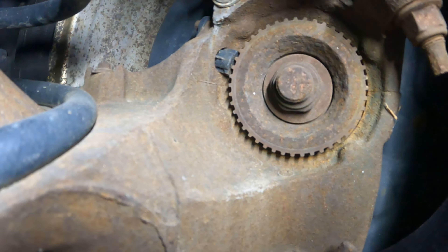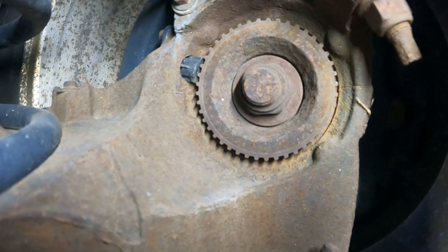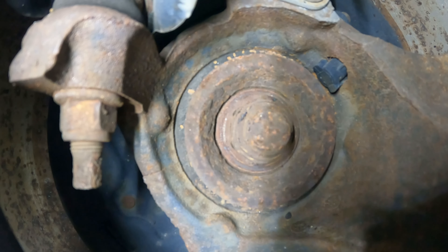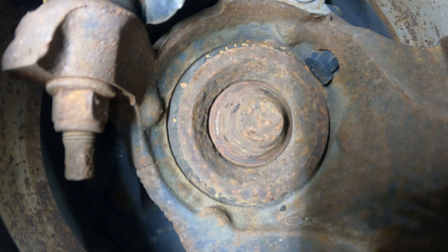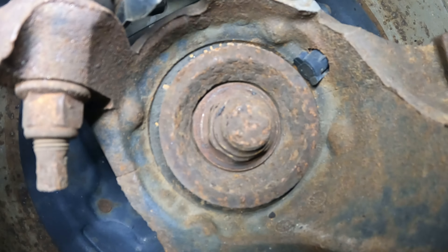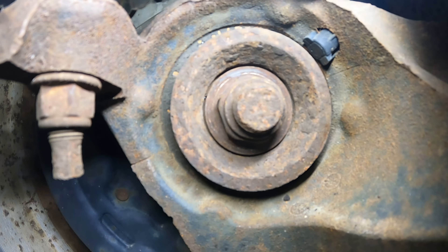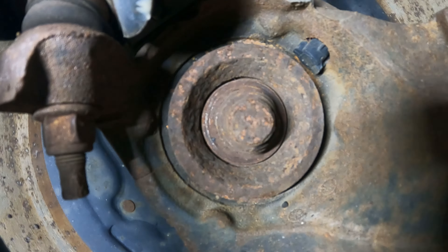We can see how this side has the tone ring and the little notches — that's what it's supposed to look like. But if you look over here, it's completely gone. So it must have thrown it. Unfortunately you have to replace that whole metal washer piece — it pulls off from the hub. It's not a lot of work from what I can see from the service bulletin. You can see it's missing all of the tone ring, so when this spins it's no longer giving any input to the sensor. The sensor is probably fine — it just cannot read. Let me show you the new part; I'll put the part number in the description.